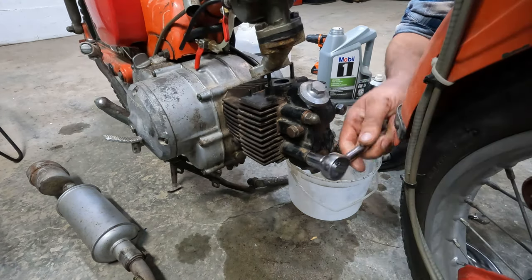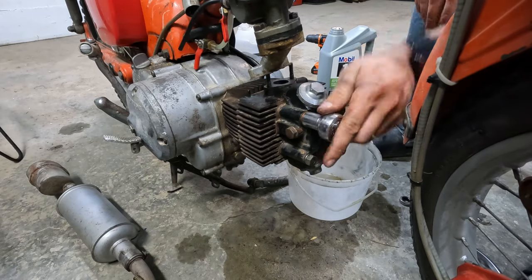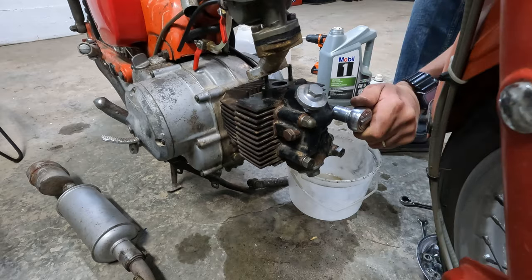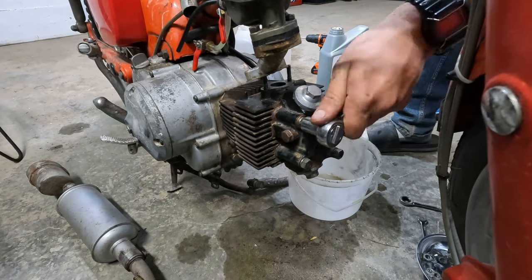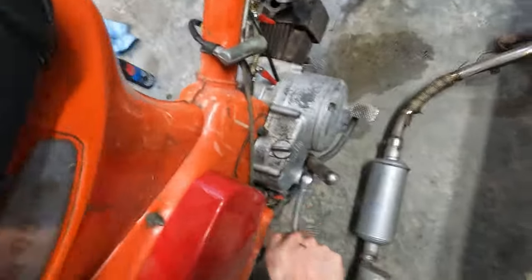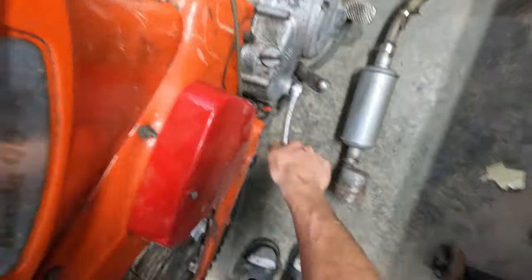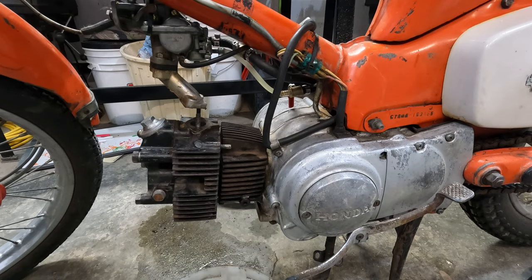I then tightened the head bolts back on in two stages. The first stage was pretty tight, and the second stage was adequately tight. It's hard to tell with this little 3/8 wrench, but you don't need a lot of foot-pounds to put the head back on a motorcycle. Then I made sure the engine would do two full rotations to make sure nothing was hitting anything inside the cylinder, and there were no spots in the rotation that were more firm than they should be.